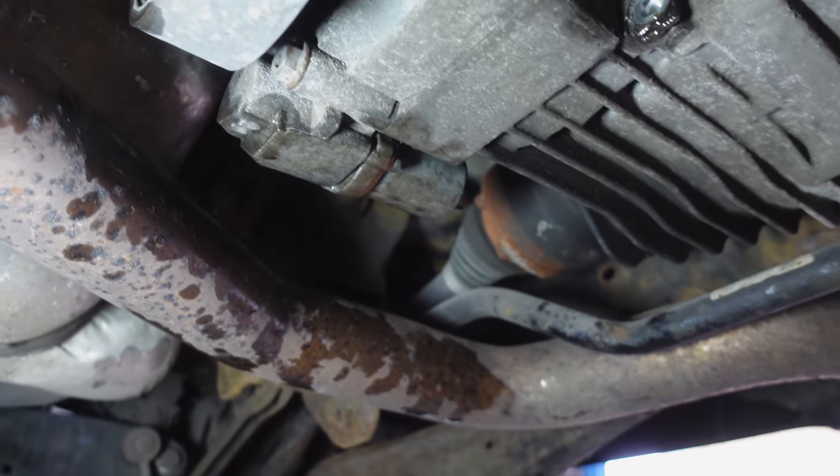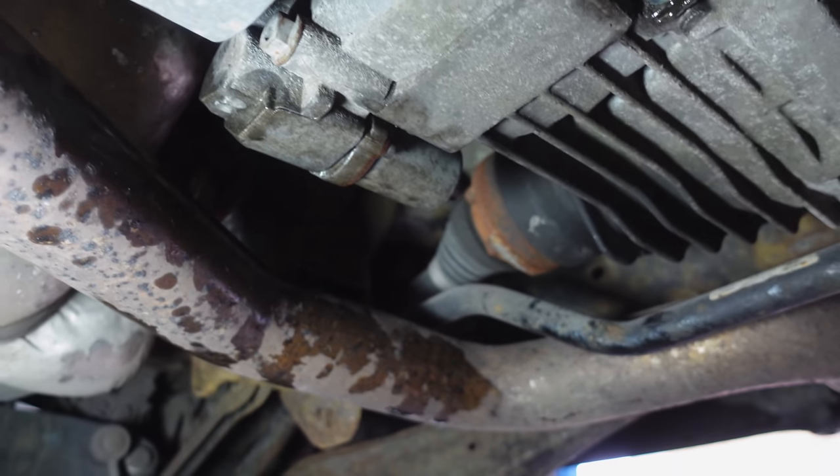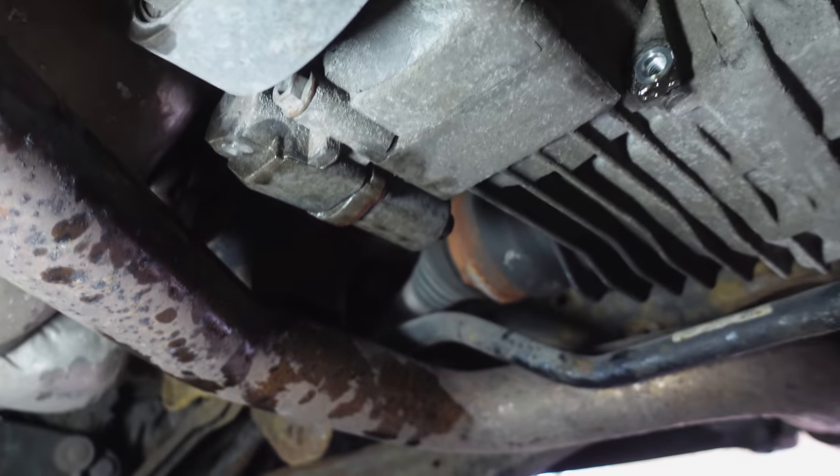So before I go ahead and change the pump, I want to do a service, and I bought these service parts. It comes with the oil and the filter, and I've read online to just give the pump a little bit of a clean. So I've done that. I've taken it apart, changed all the oil, all the seals, and all the screws, and given it a clean.